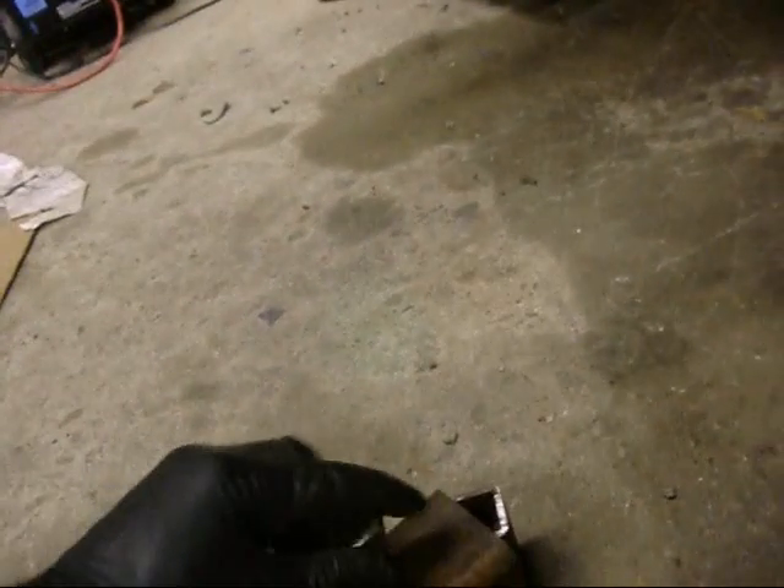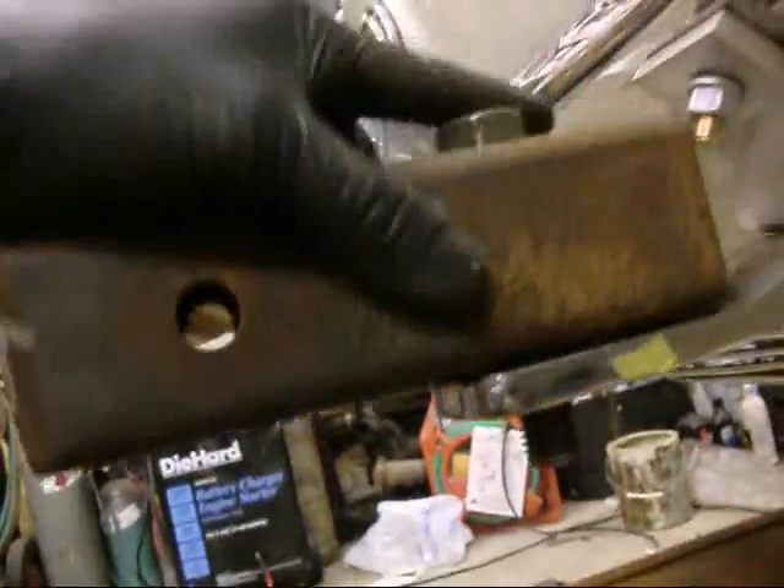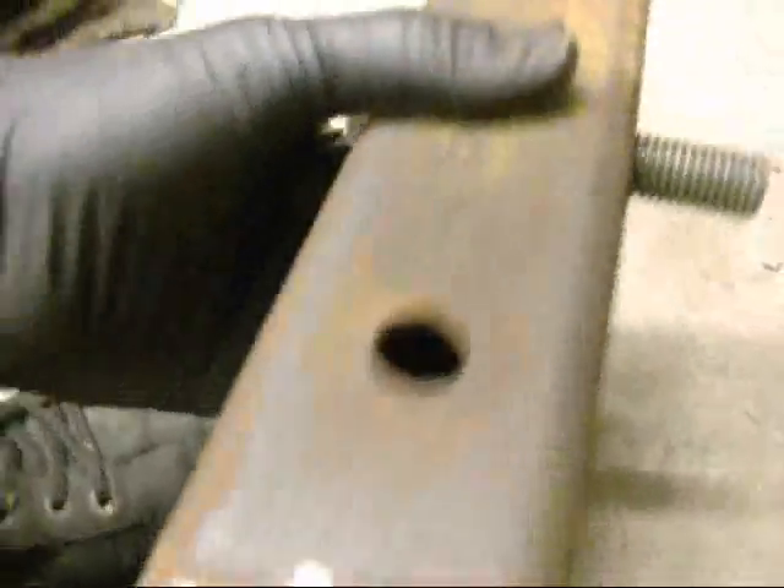I got this chunk of steel, got the hole drilled and filed it to receive the bolt. Just gonna hold it onto my quarter-bar trailer hitch like that, and when I tighten it it's gonna squish this hollow tube thin-wall. So I got a piece of square tube I'm gonna hammer in there and give it a couple of tack welds. I'm going to take this to the welding place tomorrow - the guy that rebuilds my welding equipment - and sandblast it, it's pretty grody looking.